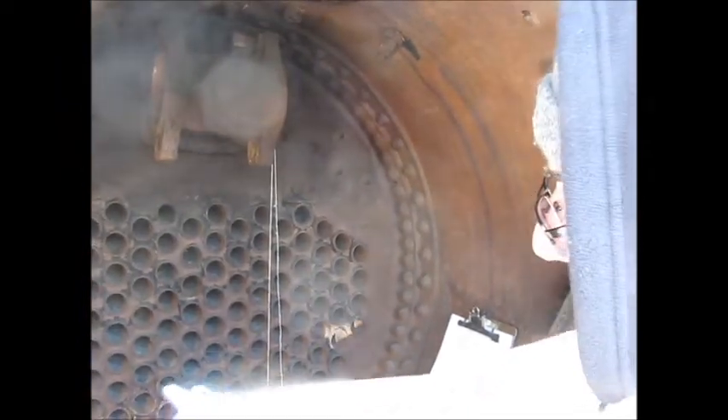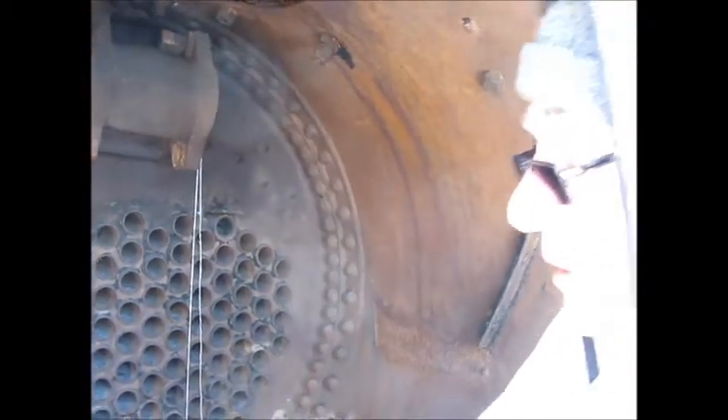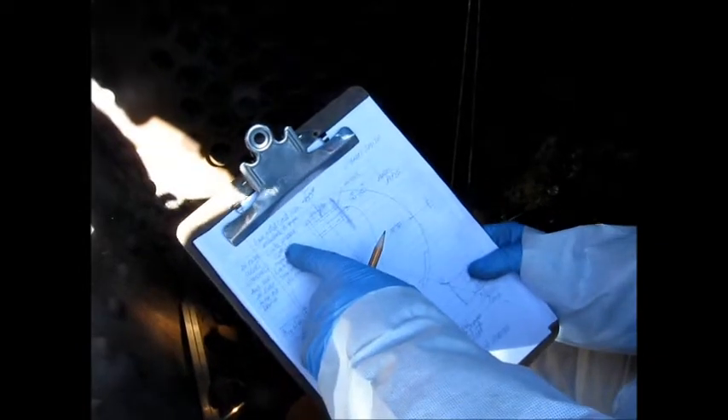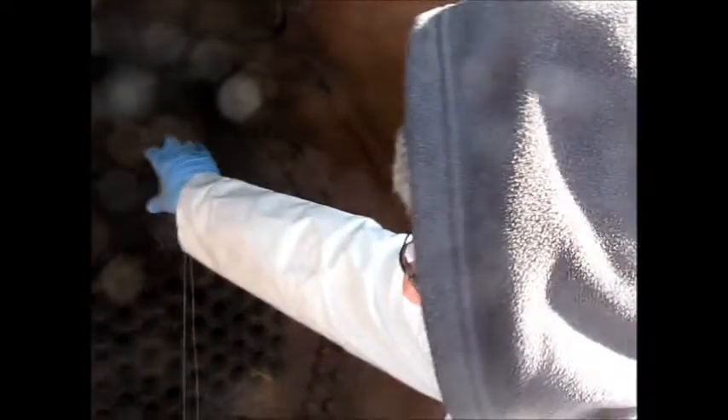I know one guy said that sometimes the temperature down here is 700 and it's 400 up here, but today I heard it was 400. Then you have this little pipe over here which is a steam blower line. Inside the cab, the engineer can adjust it for more or less. You're getting anywhere from 160 to 200 pounds of boiler pressure that comes out through this header housing. Then these are the header pipes, which are the castings.